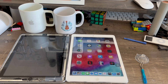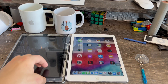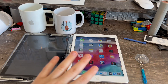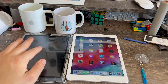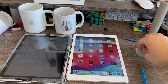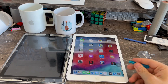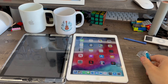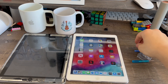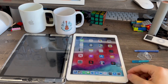Before I get started, we'll need a few tools in order to do the transparent iPad mod. I'm one of the very first people on YouTube to ever do this — I've seen so many tech videos from 2013 up to now and no one has ever covered transparent iPad mods or any iPad mod before. First, you'll need a suction cup to pry up the screen while heating the adhesive. Next, a Phillips screwdriver — this is the most important tool; you'll need it to undo the screen clips and scrape away the vinyl. Next up is a spudger, used to release the glue while prying up the screen. And lastly, if you have an LTE iPad, you'll need a SIM card ejection tool, but since mine is Wi-Fi, I don't need that.